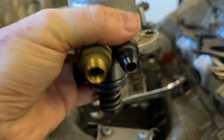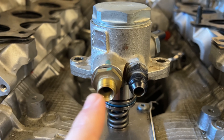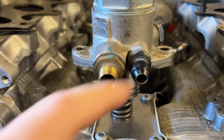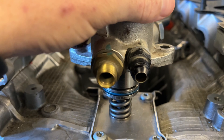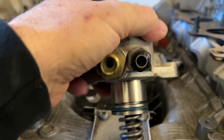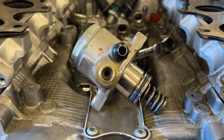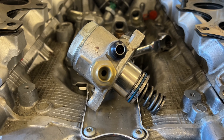You're going to shake it out, set your pump back up, poke your power and ground back up, spray brake cleaner in the other side until it comes out the fuel feed line, deactivate your power and ground, and you're going to reinstall. That should get your high-pressure pump coming back to life.